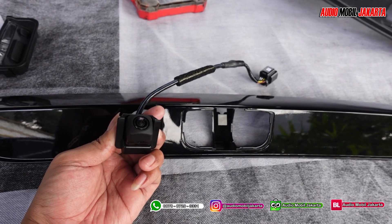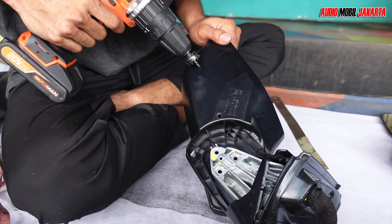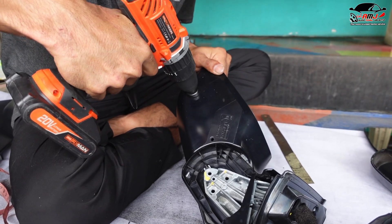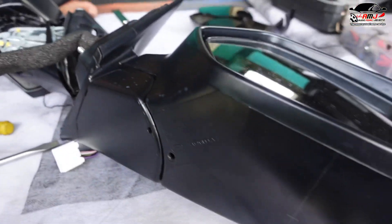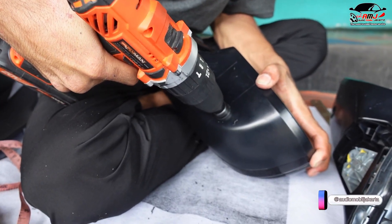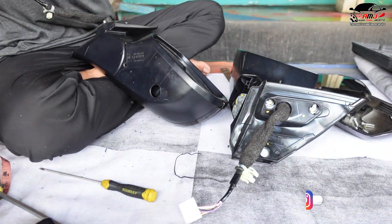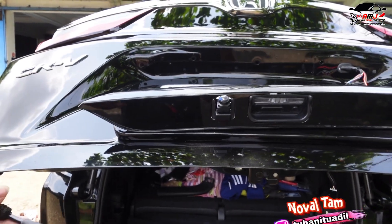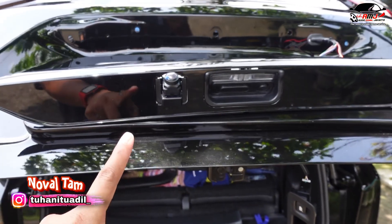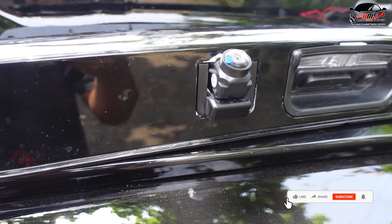Okay, we'll install it now and replace the camera. We will drill the side mirror to fit the camera lens. We've already measured it accurately. That's the left mirror, and this one is the right mirror. For the rear camera, we have also done the replacement. The original camera cable is not cut — we release it from its housing or camera mount bracket.